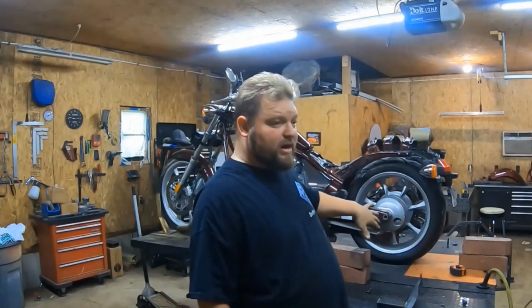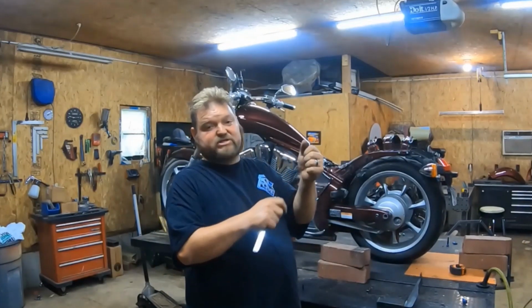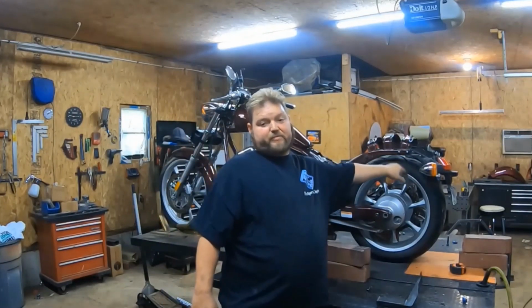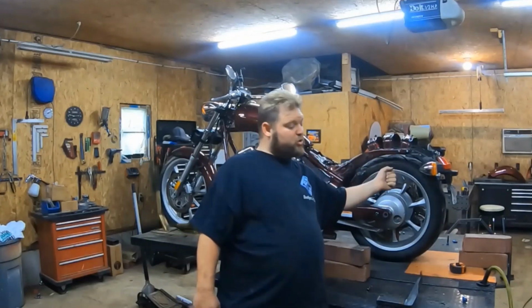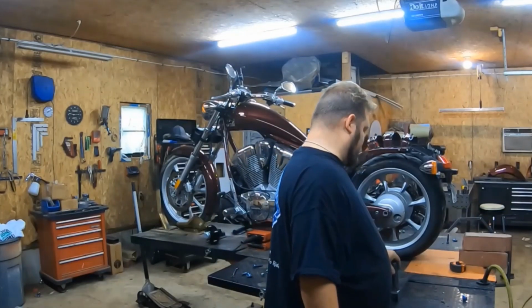They can move about 1/16 of an inch. Put the rear end on, bolt it to the front too, and then you can have that slight movement so you can make it easier on yourself, because if it's off that 1/16, you're going to be fighting with it. So then you'll bolt the rear one on, and then you'll tighten these bolts up for the bracket, and then you're done. But I would leave it a little loose so you can move that little 1/16 of an inch, because they're actually slotted holes, and that way it'll line up just fine. Once you bolt it down, it's good.